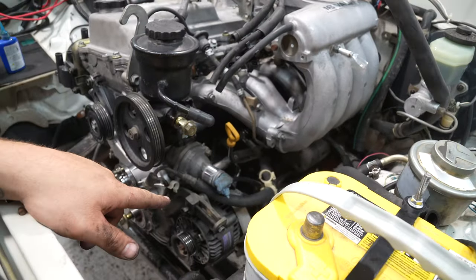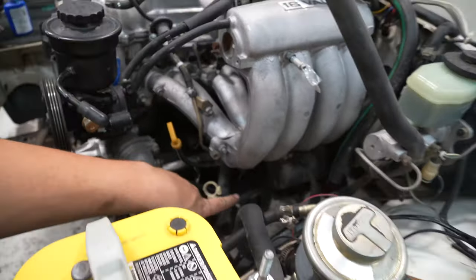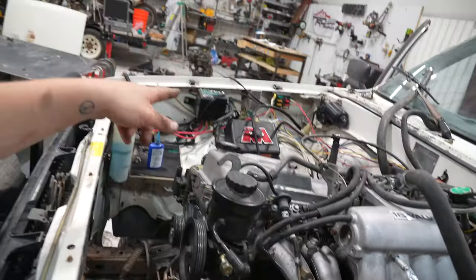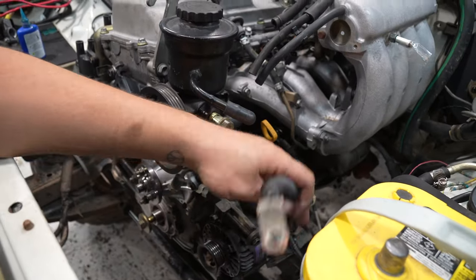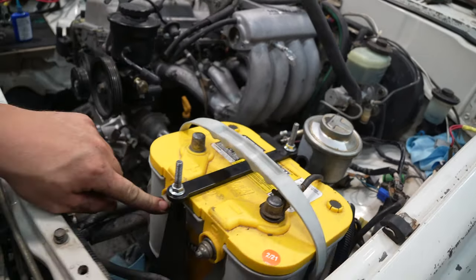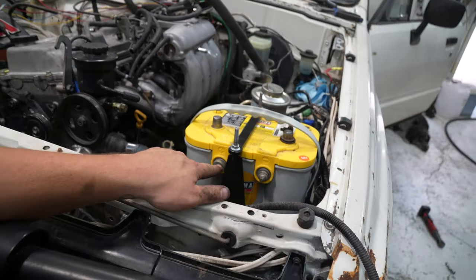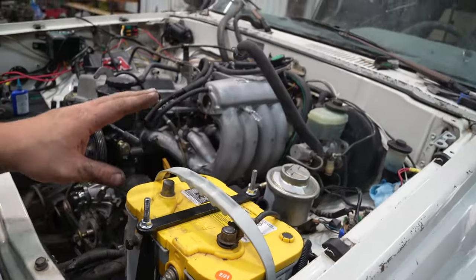So we got the alternator wired, spliced here. We'll loom this all real nice when we're done. We got the starter trigger wire where it's going for now till we get the harness wire ran to it. And we have the starter main wire right here. So everything's reaching. Alternator's going here, which we will take to here or here. We'll probably take it to here so that when he changes to a normal battery and he doesn't have this, he'll still be able to utilize it.